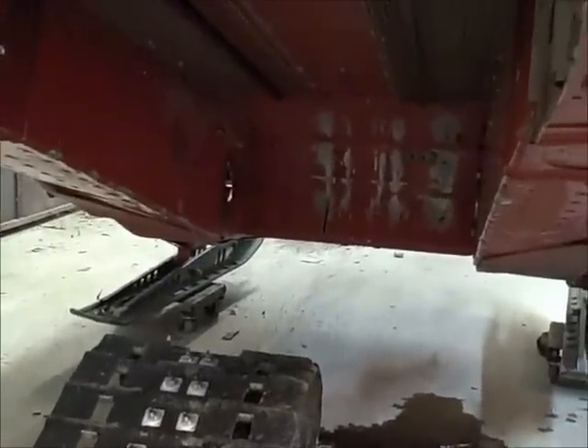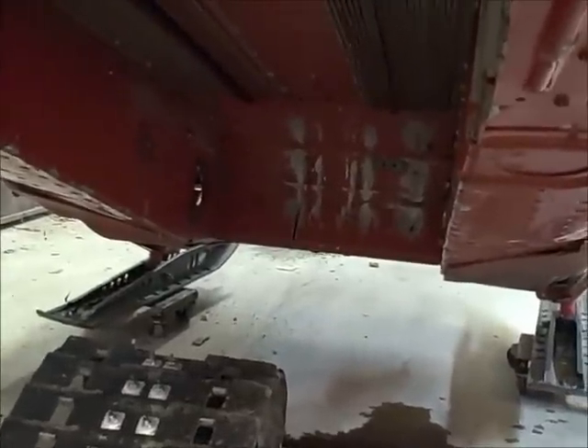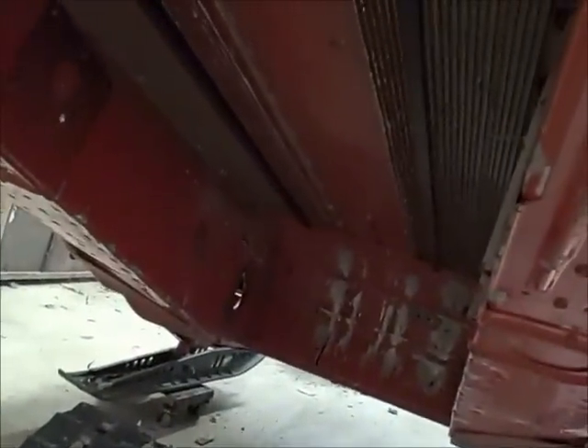I was checking out the underneath of this - you can see in the front where the studs were coming through the old track and hitting the metal on the front. I'd always know if I was losing a stud because you'd hear it hitting the metal frame. Luckily it didn't hit the heat exchanger - there's only a couple marks where it might have rubbed a little bit. The heat exchanger is basically like a car radiator; coolant flows through it and the snow that gets thrown against it is what cools the engine. If you get a hole in your heat exchanger you lose all your coolant and blow your engine, so you've got to be careful about that.